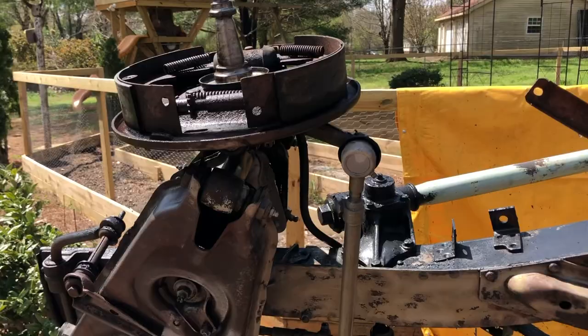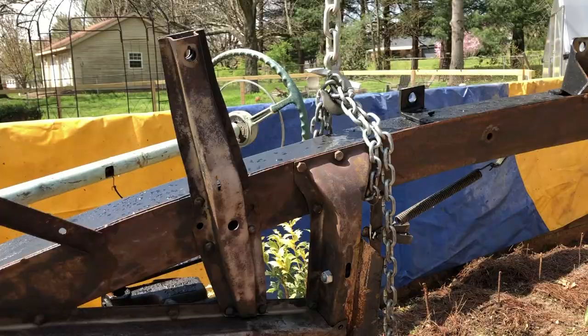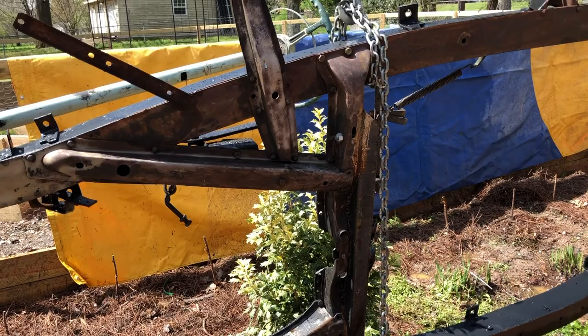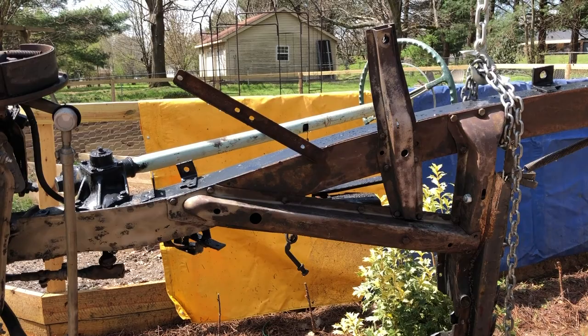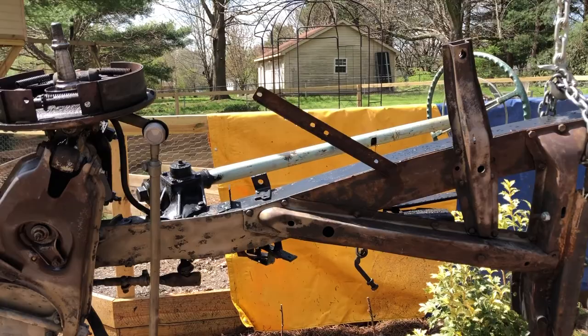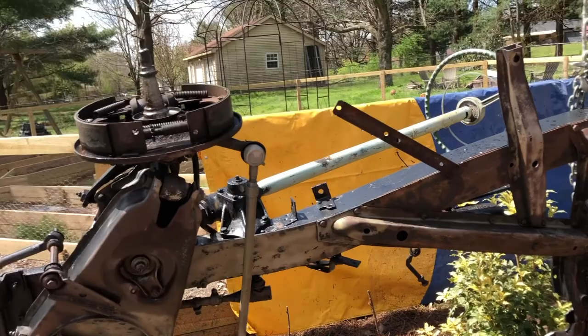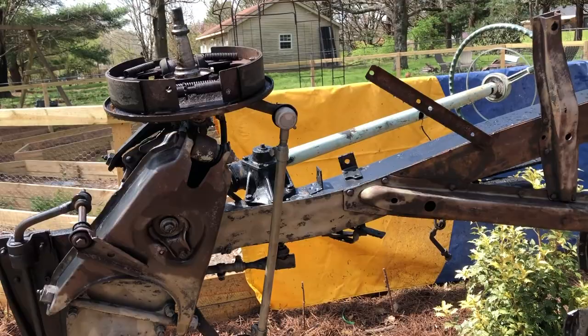It'll work. It'd be great if you had somebody with you to kind of keep stirring the bucket and keeping your hose. It's very important to keep the sand hose from looping or being too vertical because of the weight of the sand. The suction that it makes doesn't overcome the weight of the sand, which is the problem with play sand. It weighs too much. And I did use play sand today to see if it was better than the regular sand. It didn't clog as bad, but it's just heavy. And it just sits inside the loops of that hose.